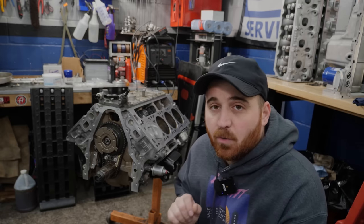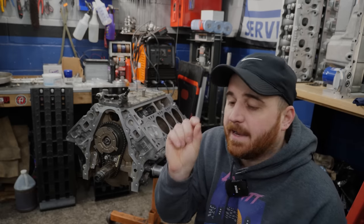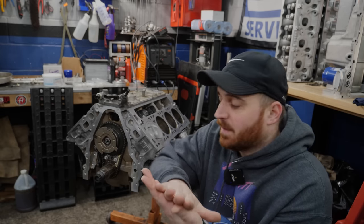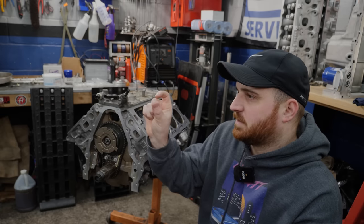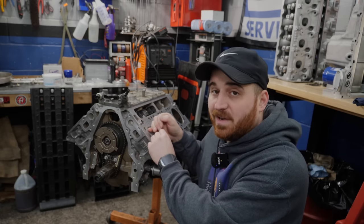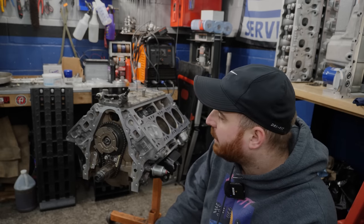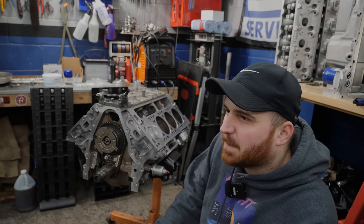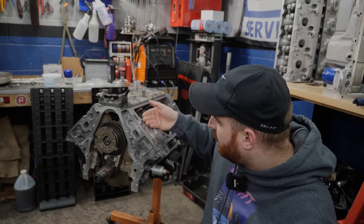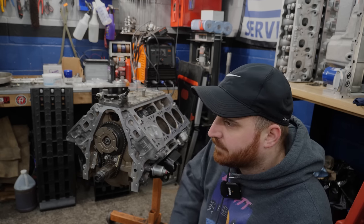And then because the collar didn't work, I just went around with the caliper and some painter's tape. I bottomed the tool out on the piston, then I'd mark 75 thou on the caliper and put a piece of tape between the valve seal and that point on the tool. And then I'd use the caliper to make sure that number was correct. In hindsight, I probably should have used a feeler gauge. That would have made a lot more sense, just to set a feeler gauge on there and then put the tape again. Yeah, oh, it's too late now.